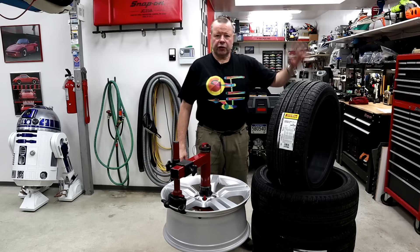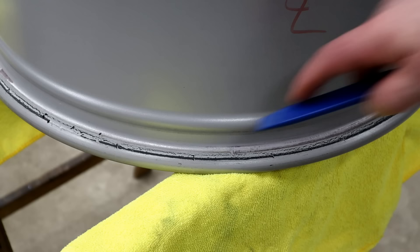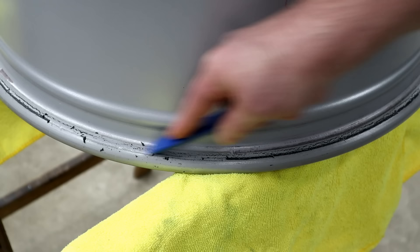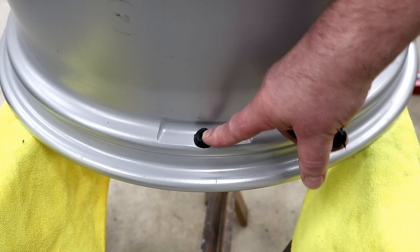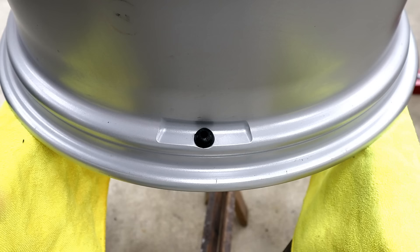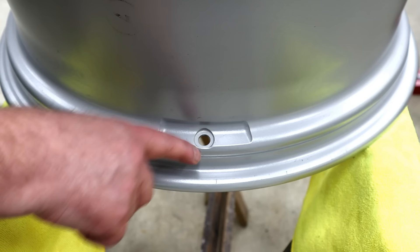The new running shoes have arrived. Before mounting them onto the wheels, I've got to check a few things on both the tire and the wheels. I like to clean the old tire residue off the rims before mounting, just using a little plastic scraper here — something that the tire shops will rarely, if ever, do. If there was any dirt in here, I'd probably spend a little time cleaning that out.